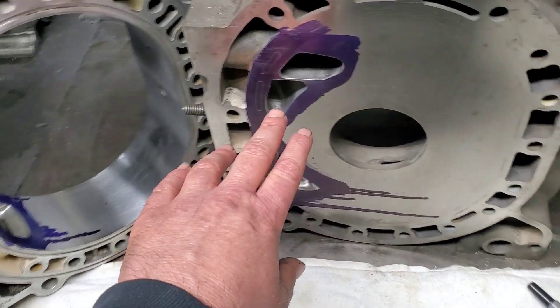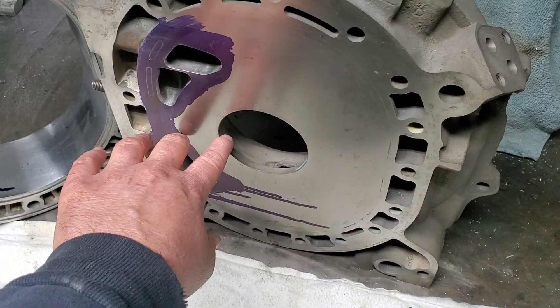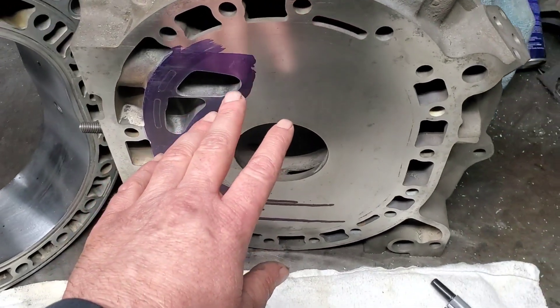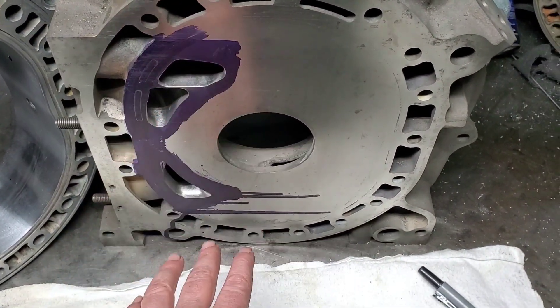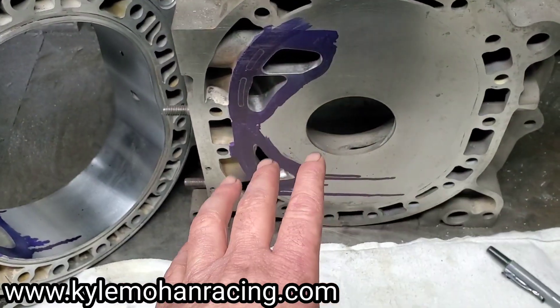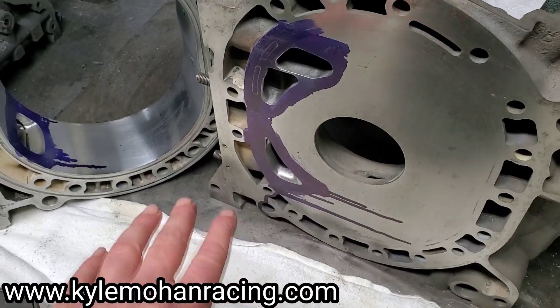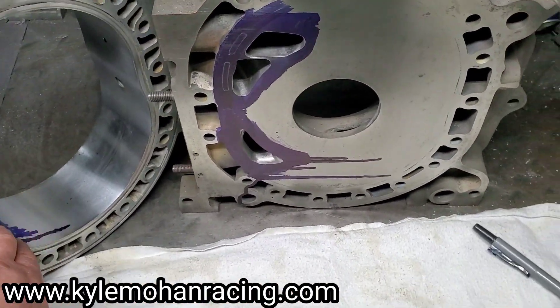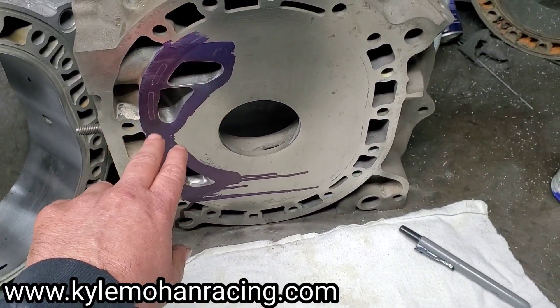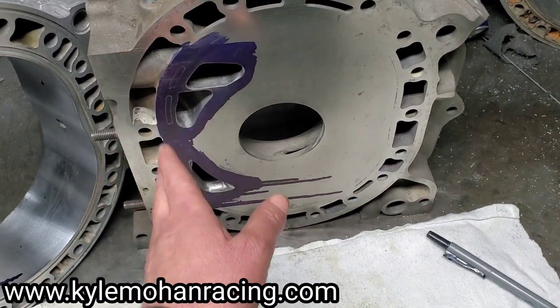I did make a decision on porting. You can see I've got one of the rotor housings and one of the side plates here in the back. I think we're going to go with street porting to start with, so it will be a hybrid multi-port — six intake port, six exhaust port street port. I'm going with the KMR exhaust template on the exhaust, and this is basically my KMR bridge port template minus the bridges, which makes it a really fine street port template.